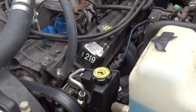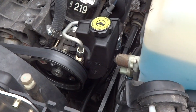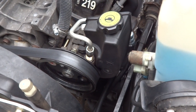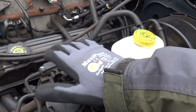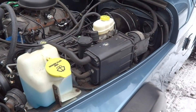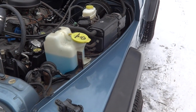All factory internals on the engine, factory valve covers. For the steering, I used a V8 ZJ steering pump bracket, a TJ steering pump, and a ZJ steering pump pulley. All the vacuum lines are tied in here to the brake booster. We've got all the factory TJ emission stuff in place — I don't have any check engine lights, all my gauges work perfectly. Everything about this functions exactly as it would have if Jeep had offered this from the factory.